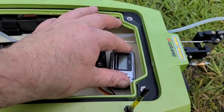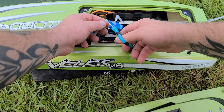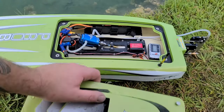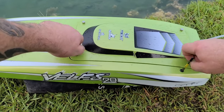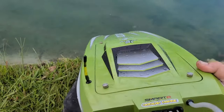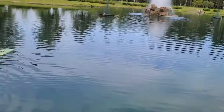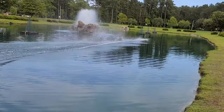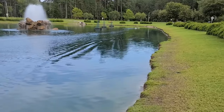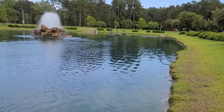Alright, zeroed out, got all the water out of the boat. So the cooling line came off - let me cut this thing flush here. She's actually wanting to come off. So that whole time I was running the boat she was dumping water in the whole time and not cooling the ESC. I'm building this boat for straights - I'm not really building it for ovals or anything. I'll bring it to the park pond here just for testing, but where I really like to run this boat is at the speed run spot.